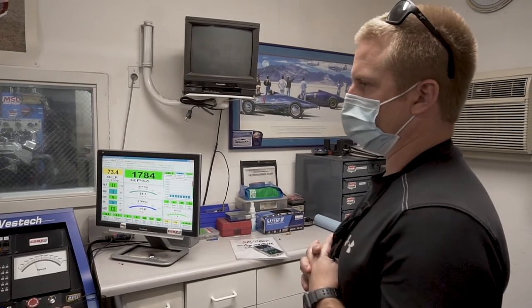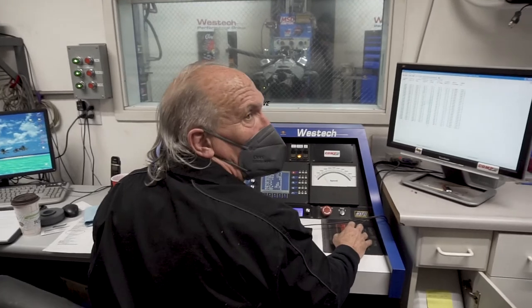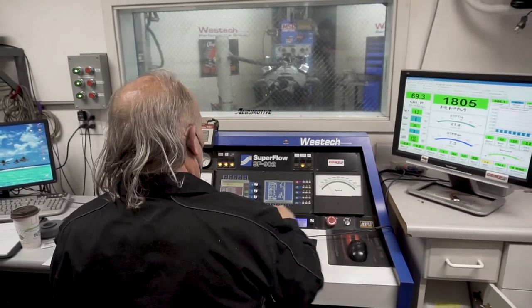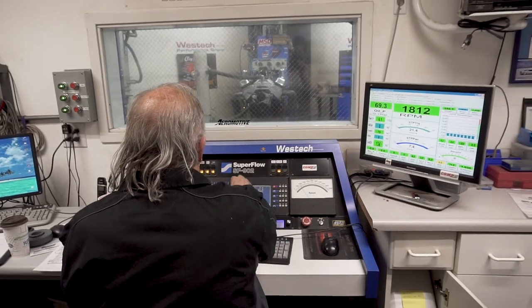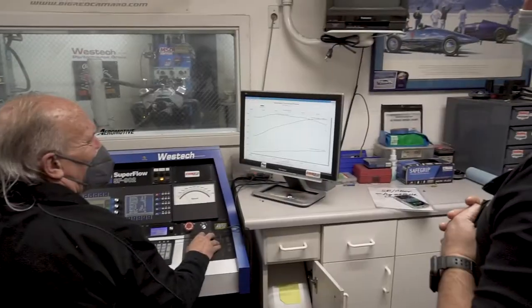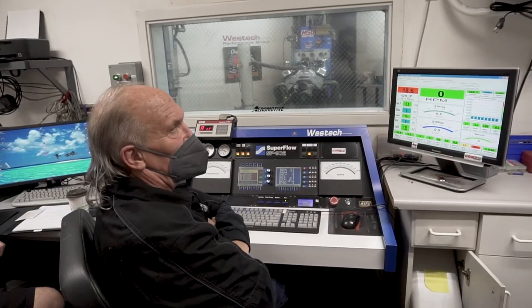Horse cam and a 400 horse cam. It's good. This camshaft, this is a 224. This thing should idle at 12 or 13. There you go. Which is enough for power brakes. There we go. 400. Just like that. First camshaft test.